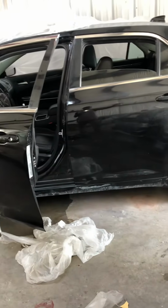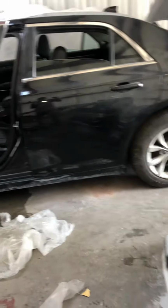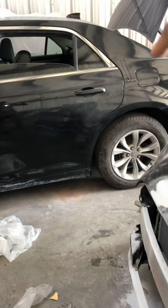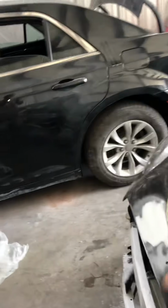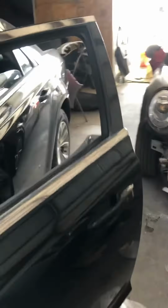So I said, okay, if I worked on the tank, probably there should be a tank issue, but I don't want to go through the seat to check or diagnose the fuel pump itself. So I traced the pump relays. There is one fuse box at the back here, and there is another one at the front. So I went ahead, popped it out, followed the instructions on the cover, and I realized the easy part was the back. So I tackled it.